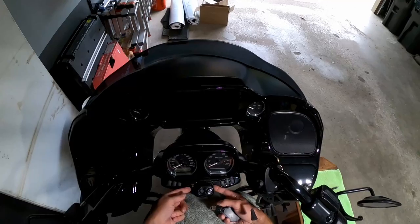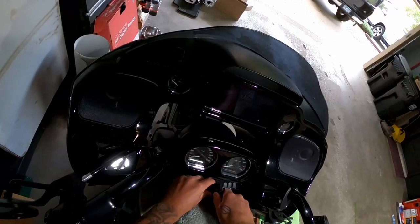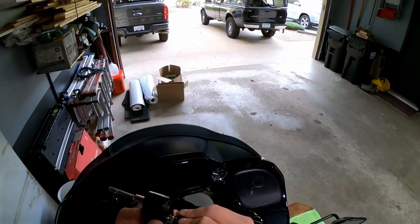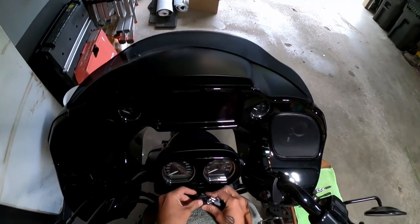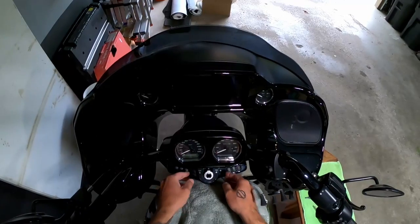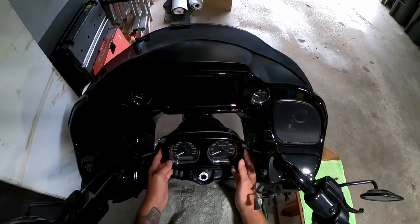Here's a little tip — they might tell you to just try to take this piece off while it's on there, but it makes it really difficult, and this piece is like a $60 part. So push the key down as if you were locking the bike and turn the key to the left — this whole thing is just going to pop right out. I recommend you keep the key in there, but I'll take it out now and show you how to get it back in. If you try to put it in as it sits it won't go all the way in, so stay tuned. This is a delicate part — try to get a fingernail or two underneath the bottom of it and just pop it out, and there you go. At this point you can pull this piece right off.